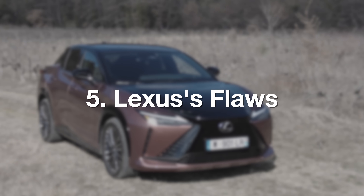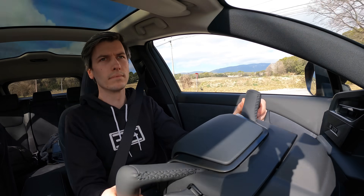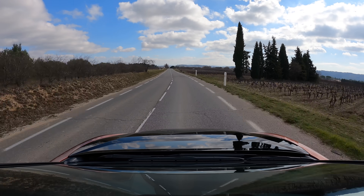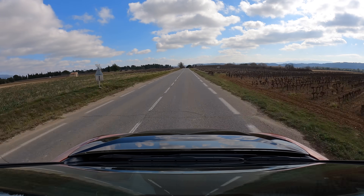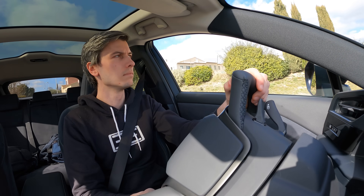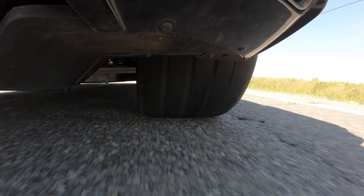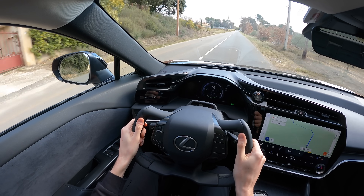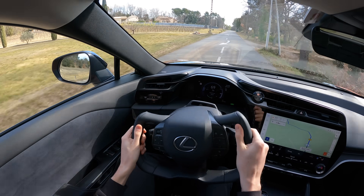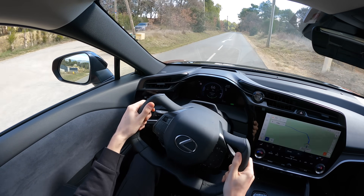Finally, let's talk bad news. Overall, the system is very well thought out, but a few things stick out to me as flaws. First, response — and I have to give Lexus credit here, because they absolutely have the right approach, it's just the execution is a little off. If you happen to be on the highway and wildly jerk the wheel one direction or the other, it's completely possible for a steer-by-wire system to have a controller that says nope, your input was too aggressive, we're not going to allow it. Think of it like traction control, but instead of preventing wheel spin from acceleration, they prevent steering inputs that ruin your stability. Of course, stability control will do its best to help prevent you from spinning, but Lexus will absolutely allow for idiotic steering inputs. You want to flail away on the highway? Go ahead — you're in control, you get to decide whether you crash or not. Lexus isn't going to interfere.